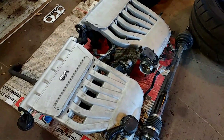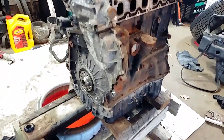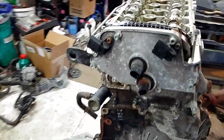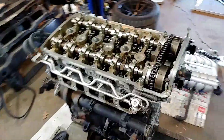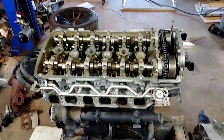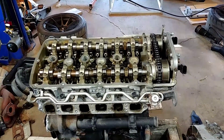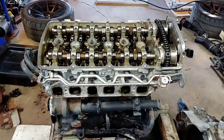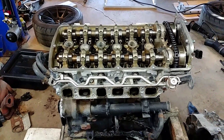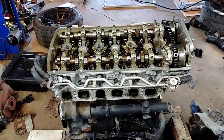So I'm going to keep everything on the top of the engine from the 3.2. The only thing I need is the oil pan out of a 2.8. I'm going to strip this engine down completely, keep the parts that are still good, throw away the block. This head might eventually get modified to go on a 3.6 — that's something I'm looking into for the future, doing a hybrid with the new 3.6 bottom end and a 2.8 or 3.2 head if I ever get my hands on one.